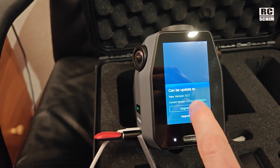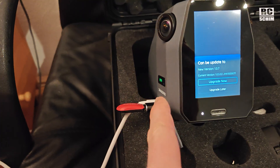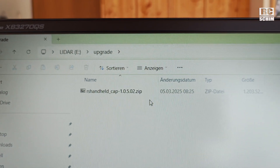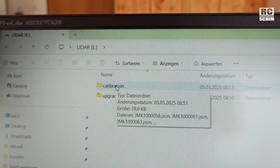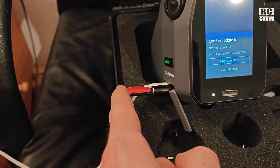It's quite important to make a firmware update on this device, so go ahead and download the latest version. You'll find links in the description. From version 1.05 in March to 1.07 currently in June 2025, you have to put the firmware onto a USB stick in an upgrade folder with just the one gigabyte zip file in it.